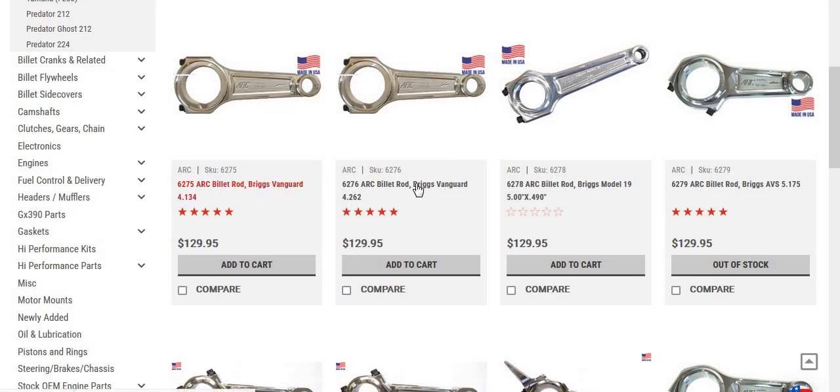The piston going up and down has perhaps less vibration, and the piston stays at top dead center a nanosecond longer during the burn. That's why they use long rods versus short rods. If you want a high compression long rod, you have to use the dish piston and machine it down. If you want a high compression short rod, you have to get the N-Tech piston and the short rod. That's basically the same thing — with the long rod you can also have a different rod ratio and all the benefits of a longer rod.